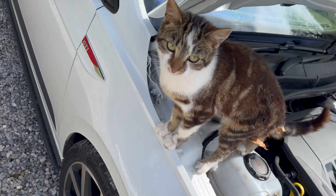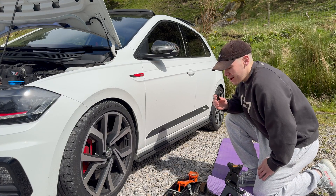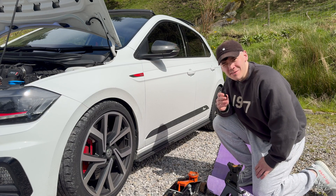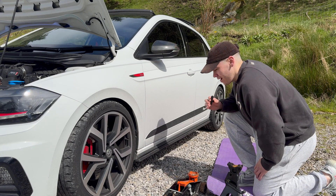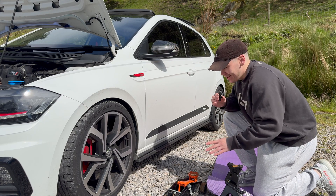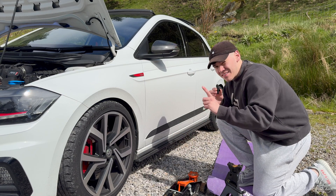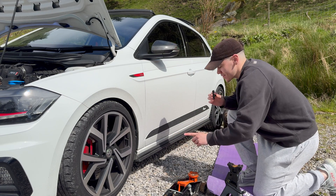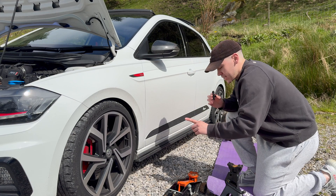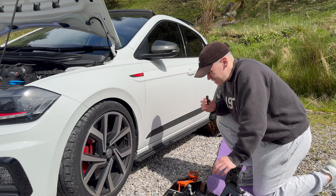Just a quick side note — I have no option but to jack this car up on gravel, which is not ideal. Jacks have to move quite freely on the bottom to work properly, otherwise it kind of raises up and brings the car towards you. This is not the safest option but it's my only option. I'm going to jack the car up and get an axle stand under there for safety.